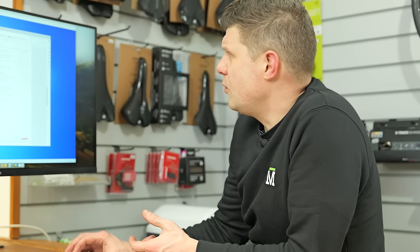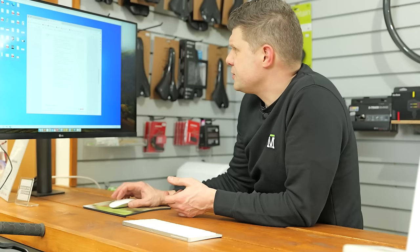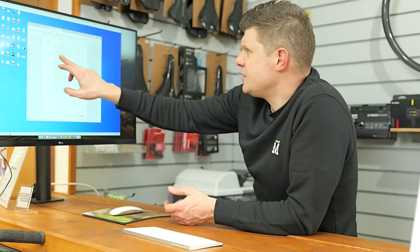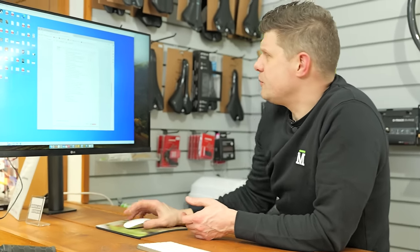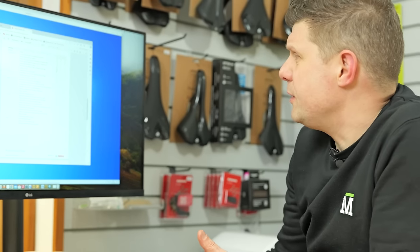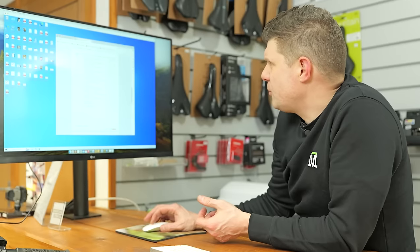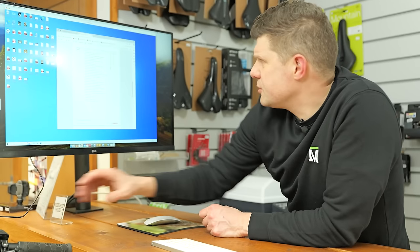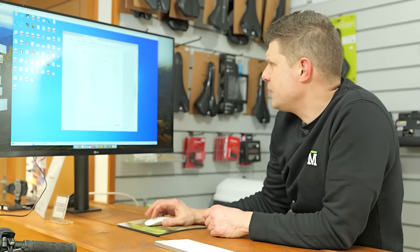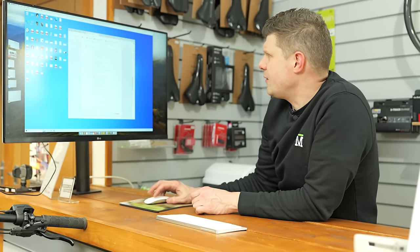So basically all the necessary function checks, we can just go through and tick all of these because these are all function checks. Visually inspect all the cables for damage, which we've been doing the whole time. That's really important. And clear all the error memory as well, which you've just seen us do. And update the software, that's all good. Control panel's all fitted and there's no damage to this control panel at all, and no cable damage. And a function test of all the buttons as well, which we'll carry out in a second.